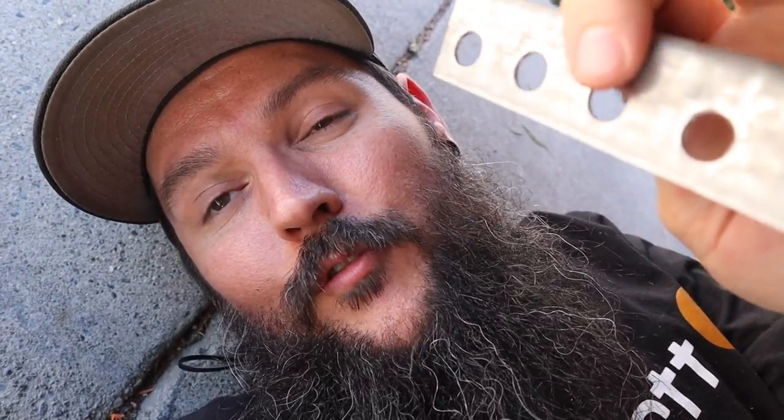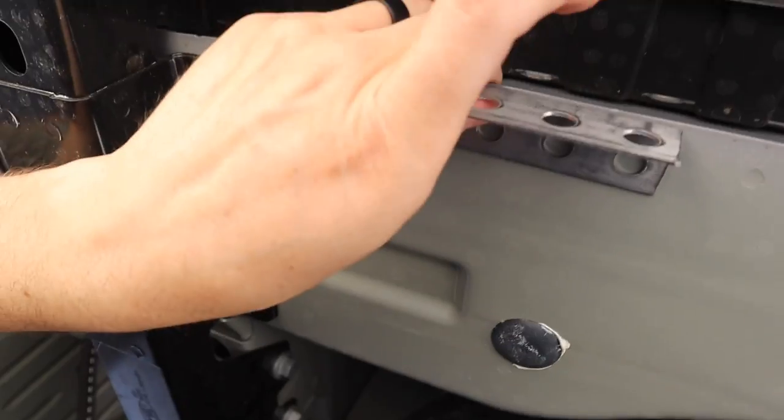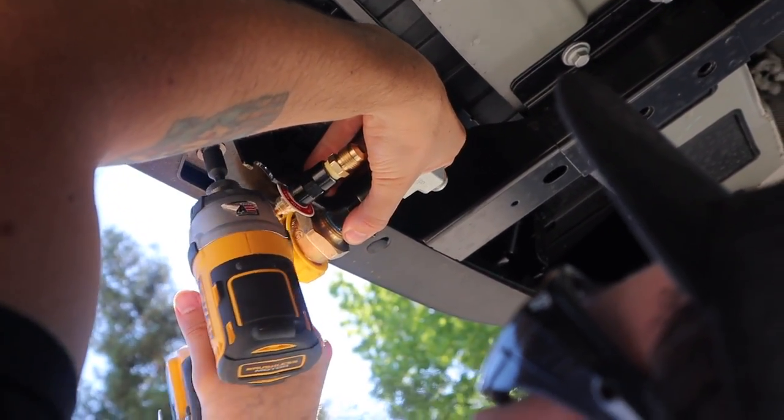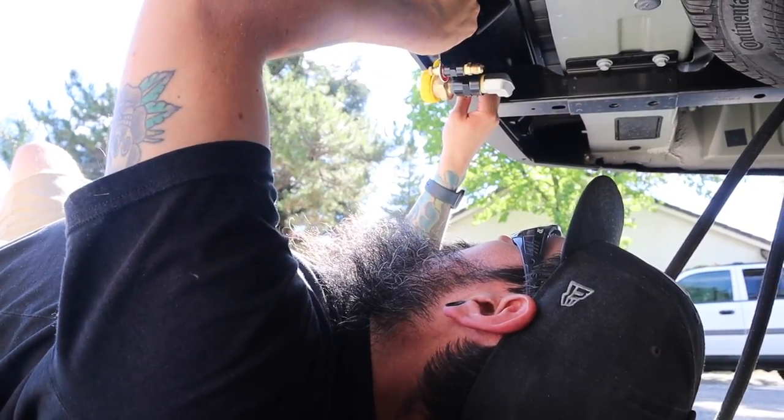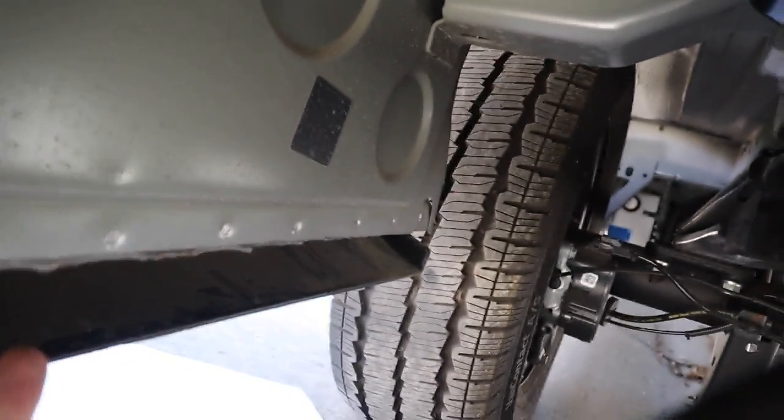Here's a quick explanation as to why I put it there. I'm currently lying under the van. This angled piece of steel demonstrates the shape of the bracket — it's designed to go flat up on a flat surface with the remote fill on the front. You just drill a couple screws to the bottom and it mounts directly to some surface on the outside of the van. Unfortunately, on the sides of the van there are no flat surfaces — the van comes down to a point, and all the cross braces are like seven or eight inches above the bottom. So my under-mount propane remote fill kit wouldn't really work in those locations. I made a hasty decision to mount it to the back of the van, and ultimately that was wrong. I should have gotten more creative.